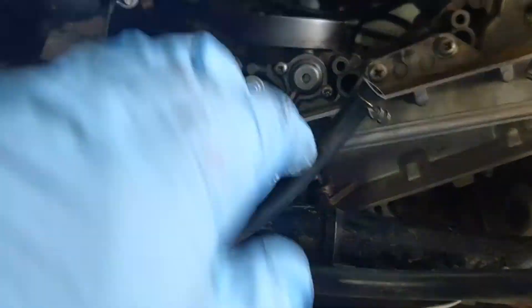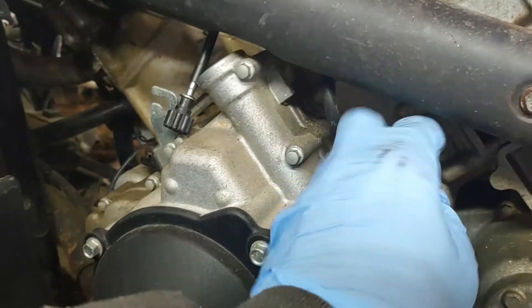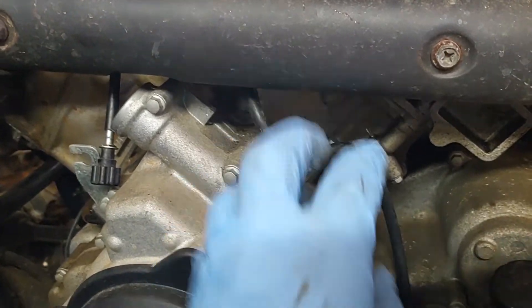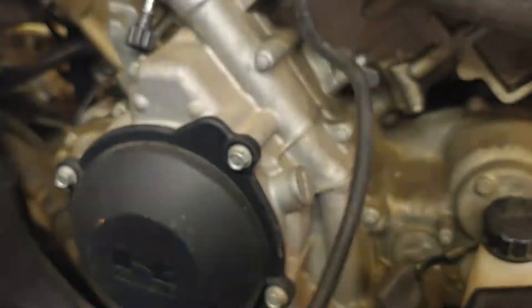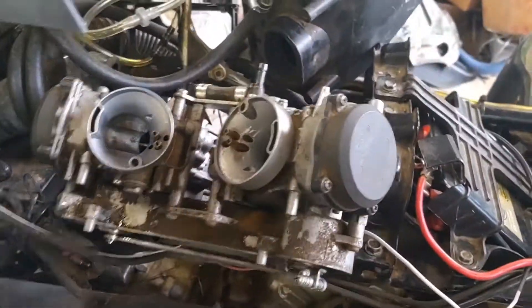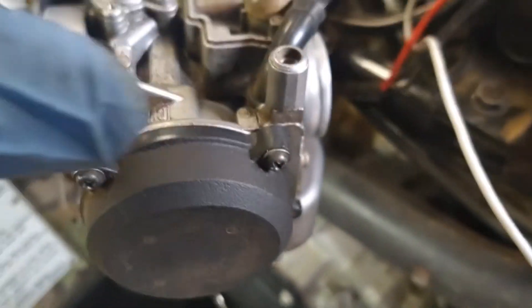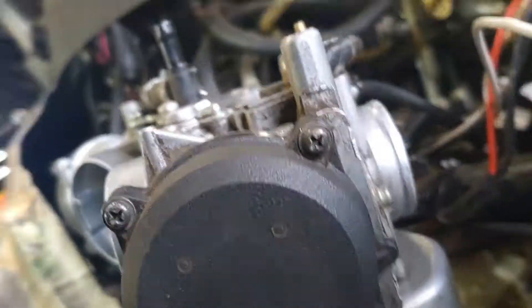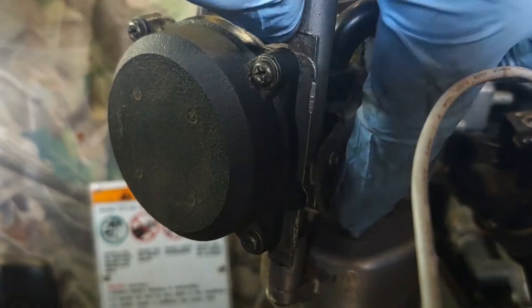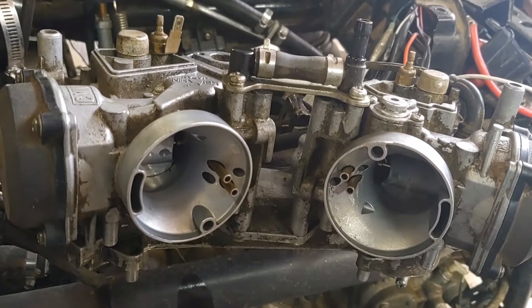Got the cable loose. One thing you need to do is take off the idle adjuster, and the drain hose just pulls out the bottom. Then the carburetor will come up and out. Put a drain pan under there - it's going to drain some gas out of the vent line holes. Next thing to do is take these chokes off - they have a Phillips head screw right there and a little bracket that comes off. Both are identical, so take that screw out, slide the bracket out, then slide the chokes out, and the carburetor will come off in your hand.